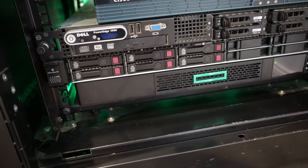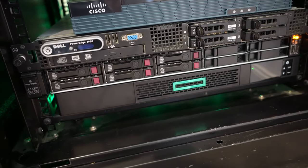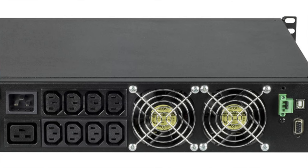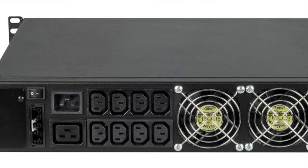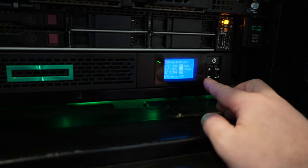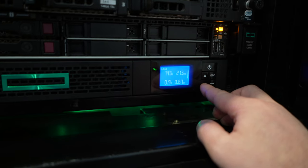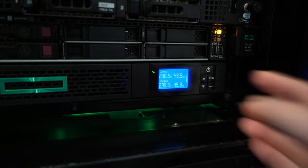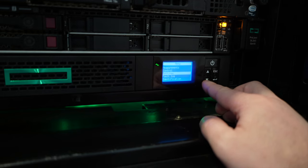What I love is the use of a UPS — an uninterrupted power supply. The one I've got right here is a rack-based UPS — a long rack-mounted unit that is basically a whole bunch of batteries. You plug all of your equipment into the back of the UPS, and then the UPS runs into your mains power. If your power gets cut, the UPS kicks in and gives you power to run all of your equipment. Your equipment will not even know there's been a power outage. On the UPS itself, you can see exactly how much load, what your input and output load is, and how much battery you'll have during a power outage to keep your lab operational.